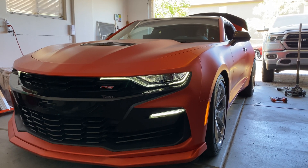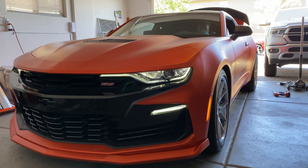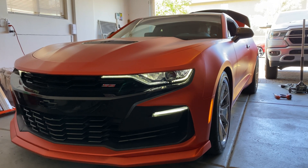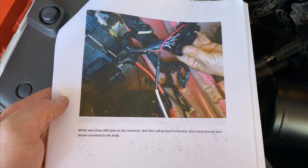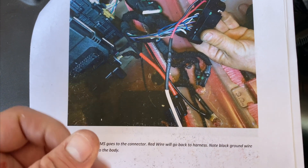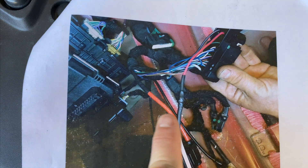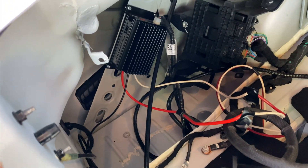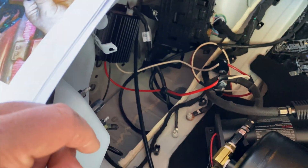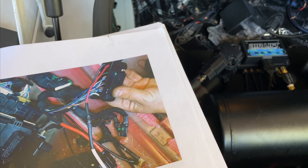I still don't hear the fuel pump come on. Okay, so I checked underneath the car — mine's obviously under the car instead of in the trunk. I had these wires crossed, so I had the red going in here and I just had them switched, so I swapped them in the trunk to see if that did the trick. So now the JMS green light's coming on, so it's getting powered, it's grounded, and everything like that. But for some reason the fuel pump is not coming on, so I've got to figure out why the fuel pump is not coming on.